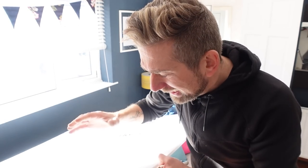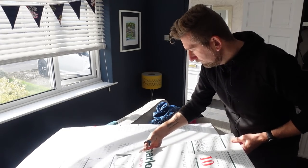This is what I like to call plastic cardboard — it reminds me of corrugated cardboard but it's actually plastic, like for-sale sign material. What I like to do is put this on the roof first and then the solar panel on top of it, because that helps airflow to stop the solar panel from heating up so much. I've got a black roof and apparently the warmer a solar panel is, the less efficient it is, so airflow through here means better solar panel performance.